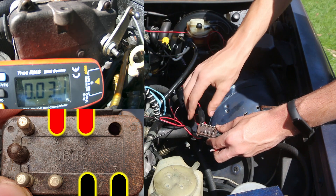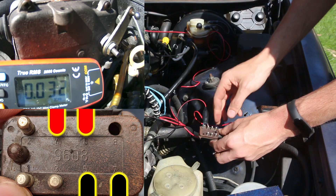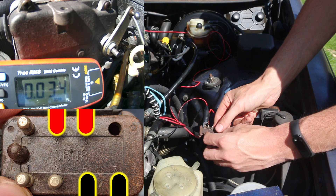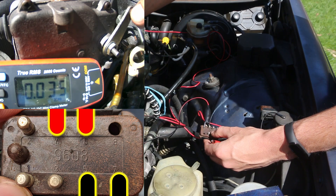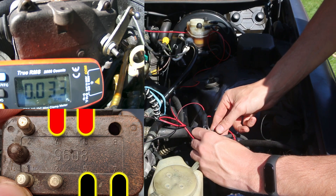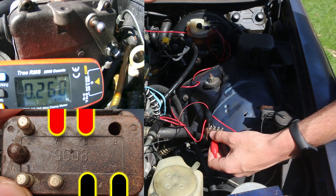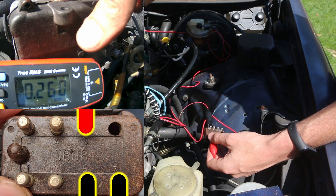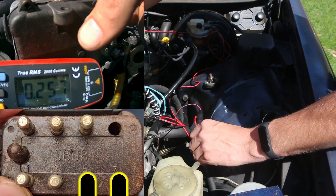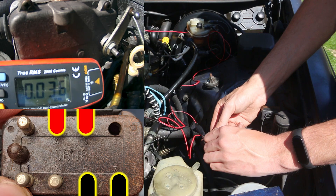For extra show and tell, we're going to connect our negative to pins five and seven, and then touch pins four and six with the positive so you can see it pull. I'll engage it and then run the motor. See how it won't come back because the solenoid's engaged? Disengage the solenoid — springs right back.